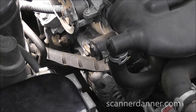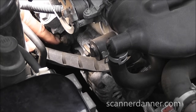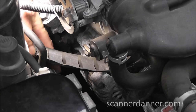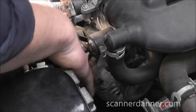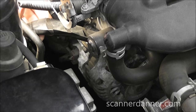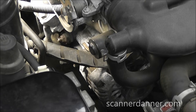Here's a shot of our alternator. What we can see is the BAT post — that's the heavy cable that comes to the alternator — and behind this hose there's a two-pin connector. I'll get you another shot on that when I'm doing testing on that. For now we're going to look at the voltage level on the BAT post of the alternator.